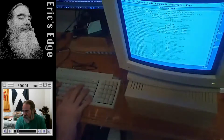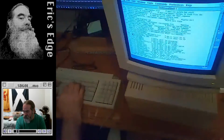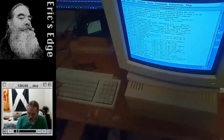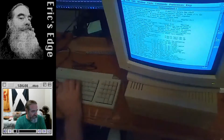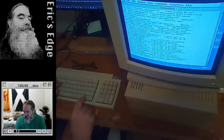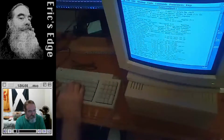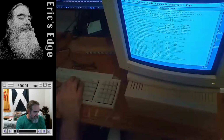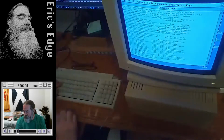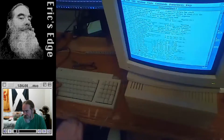Let's get to the right line, Eric. Okay, XXX, insert, wait. All right, escape. And that's the first line. We need to respawn initd. That's way down here. XXX, insert, res, make sure it's respawn, like it says right there. And then net6, wait, so wait to run syslog daemon.